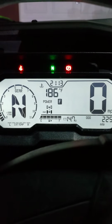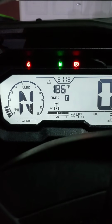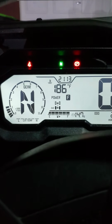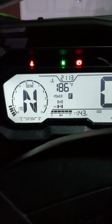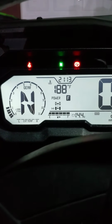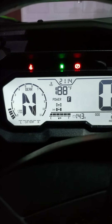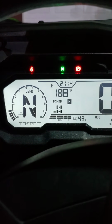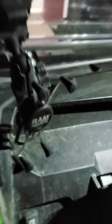You know, I don't want anybody to do anything they don't want to, but I love it. I wouldn't have it any other way. It's much cooler. The shock stays a lot cooler. And the other thing is, we have the Alba racing tune on the way here. He actually gave us the tune for the slip-on muffler. He has 3 tunes. He has stock, slip-on, and full exhaust, and he actually recommended the slip-on tune for ours since we don't have the spark arrestor or the cat in there. But again, it solved our heat problem completely. The shock reservoir doesn't get hot anymore, which everybody knows can kind of ruin the shock performance if the reservoir over there gets super hot.